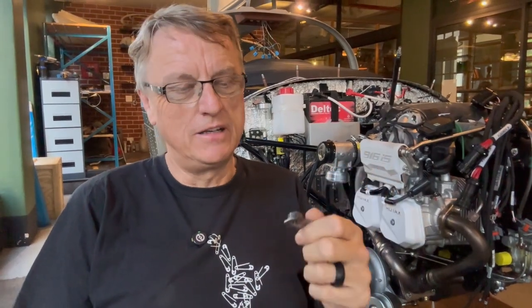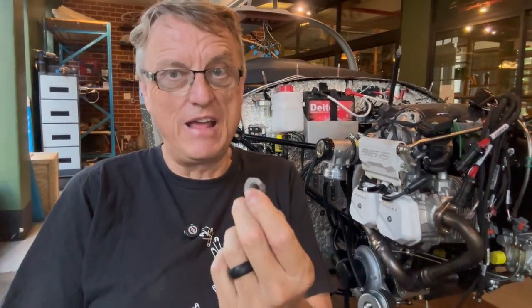That rivet is a rivet without the mandrel - it hasn't been drawn and it doesn't have the mandrel in it, so it's just soft aluminium. All you need to do is when the engine's on the crane, undo the four bolts and this thing just flops around. The easiest way is to just stick a small woodworking chisel down between the bracket and the turbocharger mount and give it a quick tap - that'll just shear right off. I used a screwdriver - same thing, couple of taps, gone. It's a five-second job.